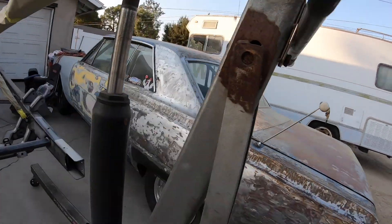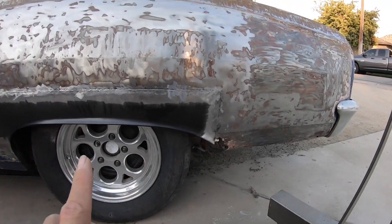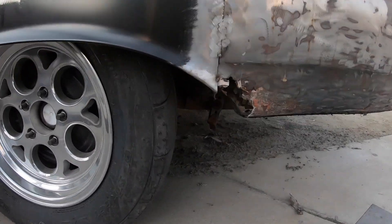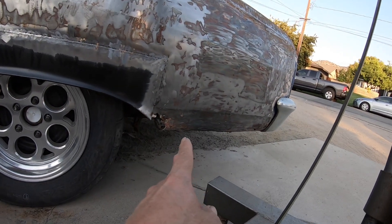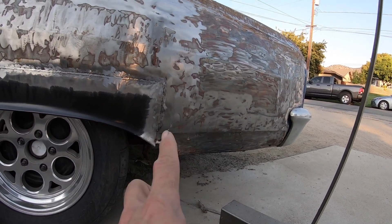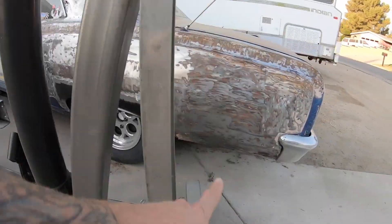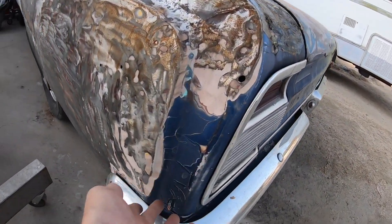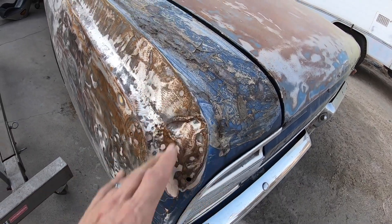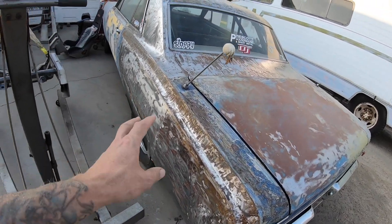That's the long-winded update. I also got this other panel in — I don't think it was shown last time. It was really roached out, which is what made me decide to get both lower patch panels. The shape of that one is kind of there but it's toast, so we'll just replace it. In all actuality this side's not terrible — we got some damage there, I replaced one piece, will replace this one. There's some fill work in the back and it's a bit beat up, but this ended up being the good side, which is funny because it was full of filler.